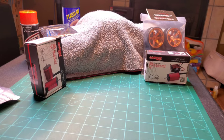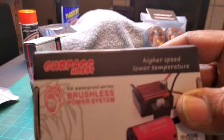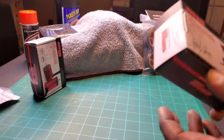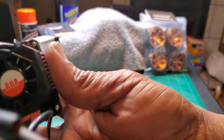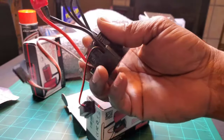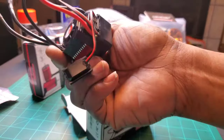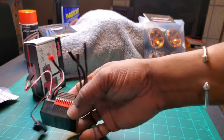Power plant time. I like my Surpass Hobby brushless stuff. Here I've got the Surpass Hobby brushless ESC - you don't need anything this strong, but I went with an 80 amp ESC just in case somebody wants to race or something. This is a drift truck, it's four-wheel drive, it's an on-road car. I can run 3S but we're drifting on 2S - this can handle 3S in case someone tries me.